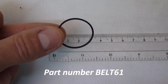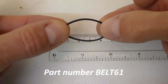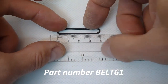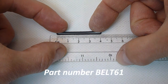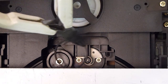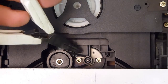Here's a precision ground neoprene drive belt, which does have a little bit of stretch, but only maybe 15 to 20% beyond its original size — that's what it needs for the correct drive tension. Let's just check the size of it. So that's coming to just about 40 millimeters, which doubled is 80 millimeters in total length. So now we've got our new belt. Let's hook it onto the main door pulley and then round the motor pulley. And there we go.